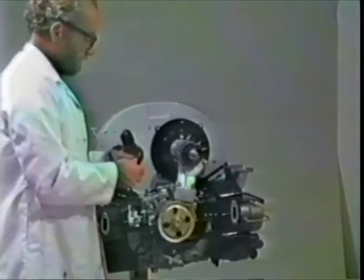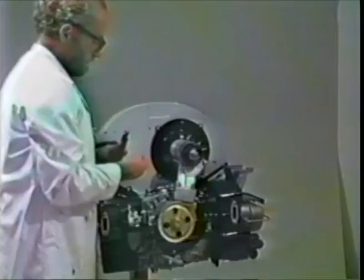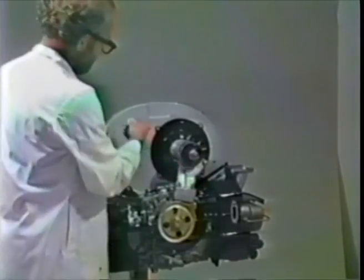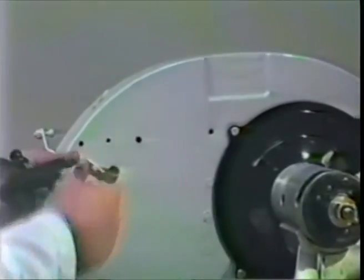Here's the oil filter can bracket. It actually goes on like this. This part covers that bolt I was talking about. And to put it on, you need two very large washers that go on the front of the fan shroud, a long bolt, actually two long bolts, the other one I used for adjusting the fan shroud, and a bracket, two brackets, an L-shaped metal bracket, and a band that actually holds the fuel line. It goes on the front of the fan housing.